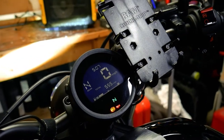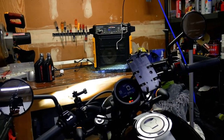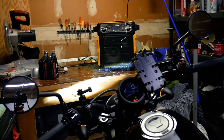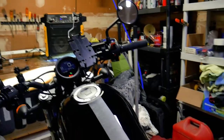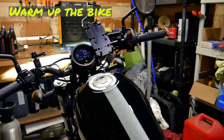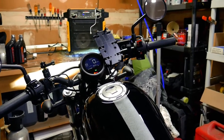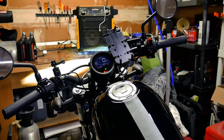I've got 555 miles on the bike, just shy of 600. I didn't want to wait until 600 because I'm taking the bike to work tomorrow and didn't want to go over on my commute. One of the things you want to do first is warm up the bike — let it run for two to three minutes, bring it inside, shut it down, let it cool for another two or three minutes, and then you can work on it. Get the oil nice and warm so it flows out nice and easy.